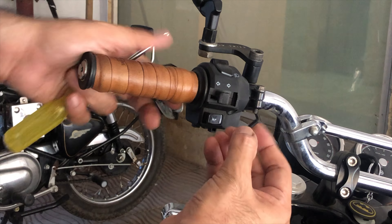On the right side, all you have to do is loosen the mirror assembly and the throttle assembly. You won't be able to remove it, as there is not enough slack to slide the throttle assembly with the handlebar still in place. The same goes for the clutch lever assembly — there's just not enough slack. The way I went about removing the clutch and brake lever assembly is by actually removing the handlebar with these levers still on, since the angle when the handlebar falls onto the petrol tank makes it easier to maneuver the levers out.